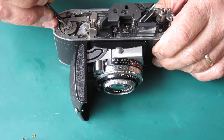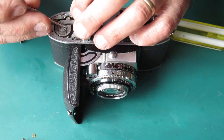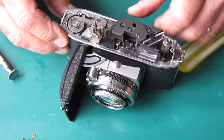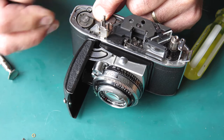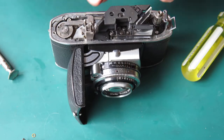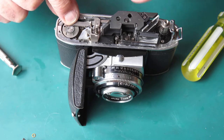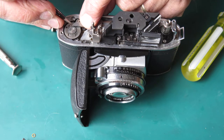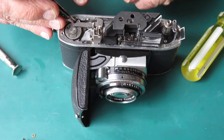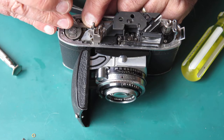There's a lot of play in that shaft there — that screw's loose. That's half the reason for that. That screw's loose on the other side too. See if I can get this rack to drop into place there — it doesn't really want to go. I think that should be just along to the next tooth probably. That rack might even be bent slightly there. Let me back that screw up a little bit — that shaft might be bent too.